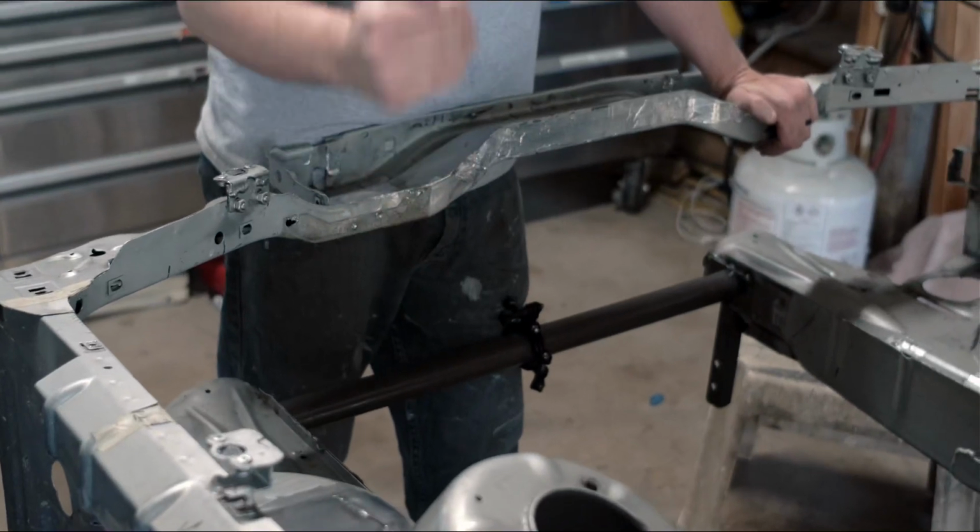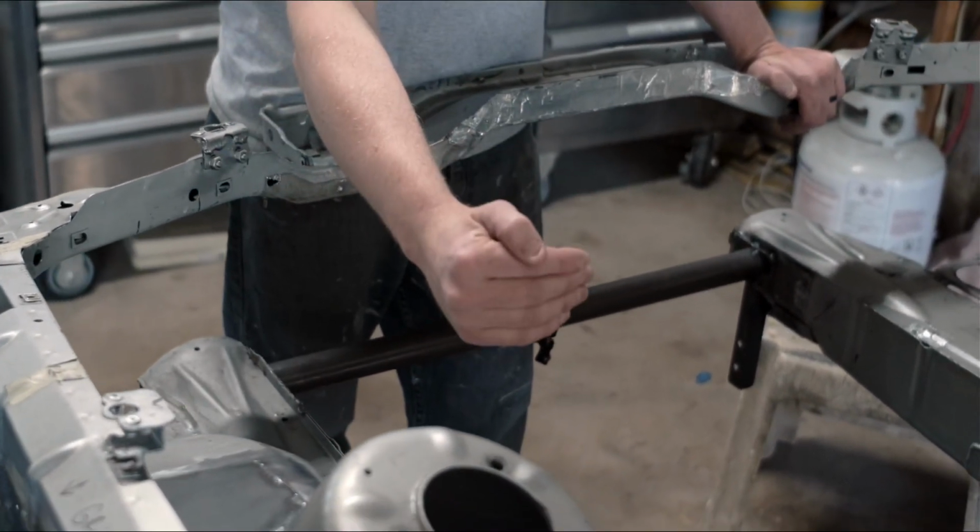All right, so getting back to what we were talking about with the tunnel and why we moved the seat back, the main thing we did is we moved the engine back from the stock location about 9 inches rearward. We couldn't quite get the full 10 inches, mostly because we needed room for the end of the transmission and where the front part of the seat came. So we got pretty close. 9 inches is still huge. That puts the front of the engine from about here to about here. So we have the majority of the weight behind the front axle, which is huge considering the DCT weighs about 100 pounds more than our ZF transmission.